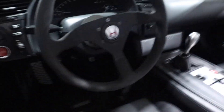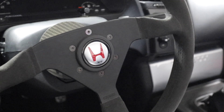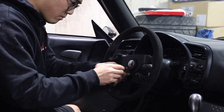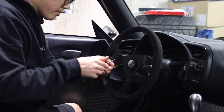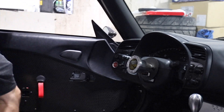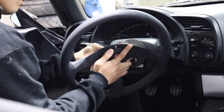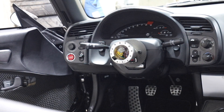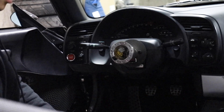Installation is going to be pretty easy. As you can see, we just have six Allen head bolts along the actual wheel that hold it to the hub. So we'll just take those off the old wheel, take off this one, and swap over our new one. When you remove the wheel, you just have to remember that the horn connector is still on there, so you just unplug that and it comes out of the car. For the new horn button, we just want to make sure the connection is going to go in there to lock everything up, and then put it together.